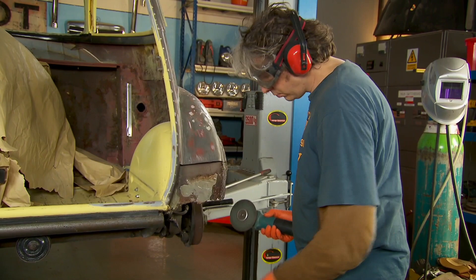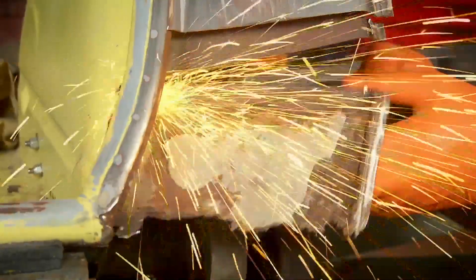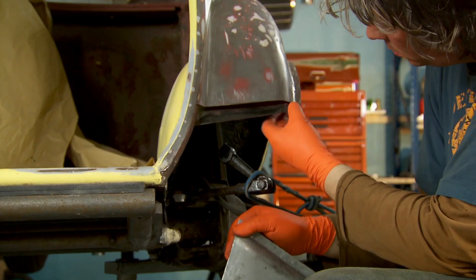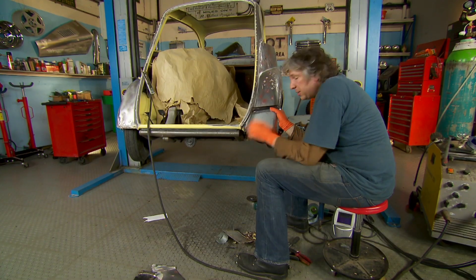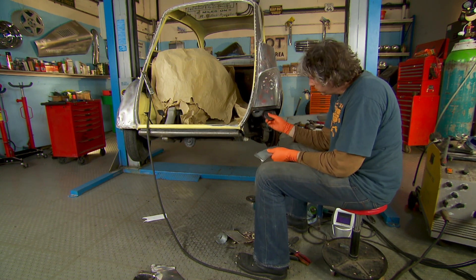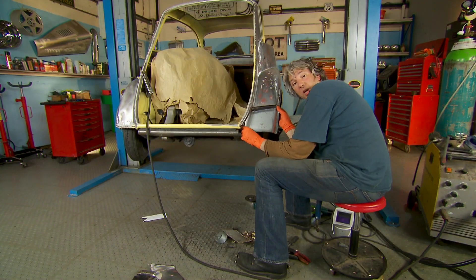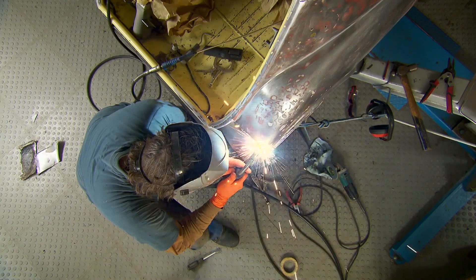Once the rotten metal is cut away, it reveals a skin underneath that has also been corroded by botched work in the past, and this will need to be replaced as well. First I weld on a steel panel that I've cut for the inner wing. I'm pretty happy this now fits, so now we get to start welding. I'm just using a couple of magnets on the back of the panel to hold it in place, and any minute now this will be permanent. A little application with the MIG welder and we've got the first piece of the jigsaw.